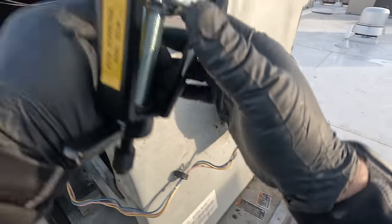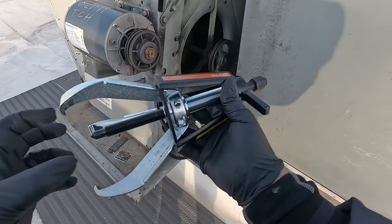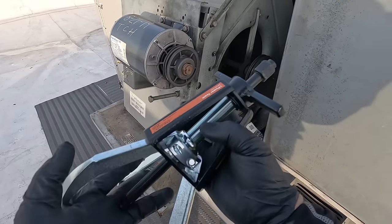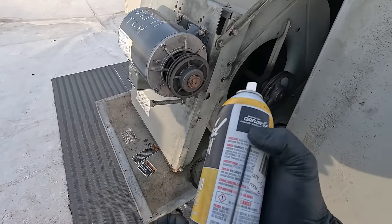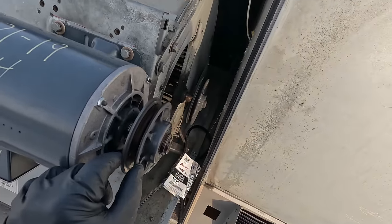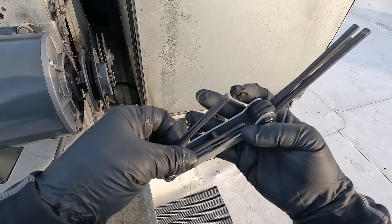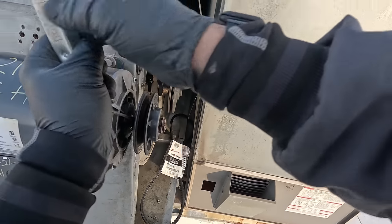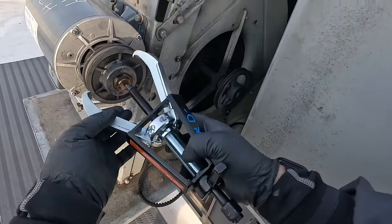I do have my Posi-Lock puller here, which I bought for pulling hubs and it has the adapters. They make these in really big ones and they are super stupid expensive — this kit just for the hub puller was like $350 — but it gets it clean off there, and after breaking some of the cheaper ones I was willing to spend it. Unfortunately TruTech Tools doesn't sell that. They are one of the best pullers on the market and they're made in America. It's more of an issue with the bigger pulleys than these little ones, but you'll see here in a second how nice this thing is. Just loosen that up a touch. This here comes around. Back up the inside one. There's the jaws — spin this one; that one right there tightens the jaws up.